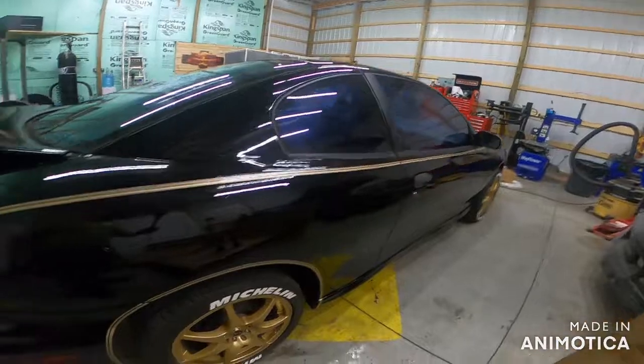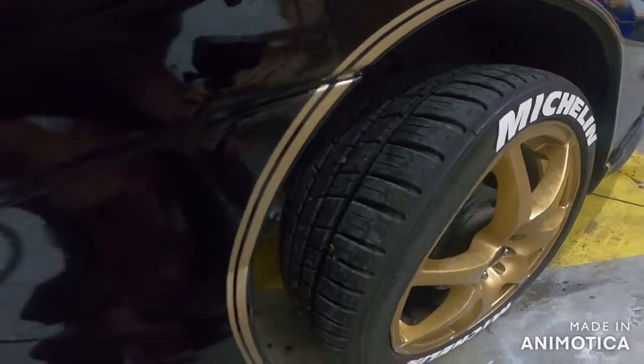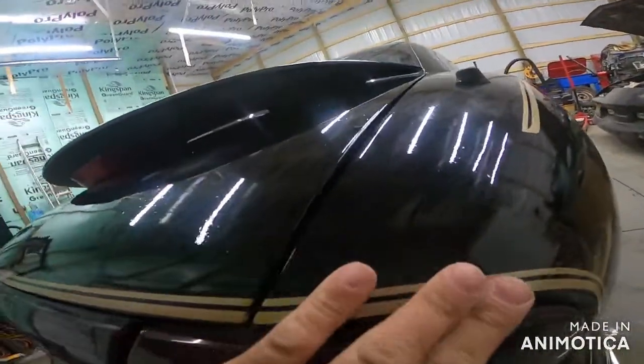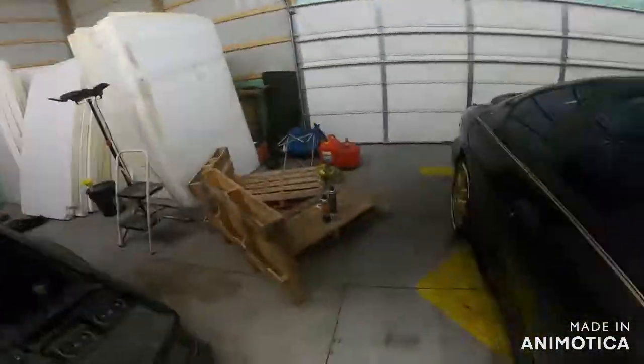We made a match down that side. If you're going to do your own pinstripe, make sure you cut little relief cuts everywhere where the body is not flat, because if not it's going to end up peeling off over time if you stretched it tight. These curves were extremely tight - go slow on those. As you peel the backing, push it down as you go. If you lay it down and don't like it, just pick it straight off. I kind of like them all.